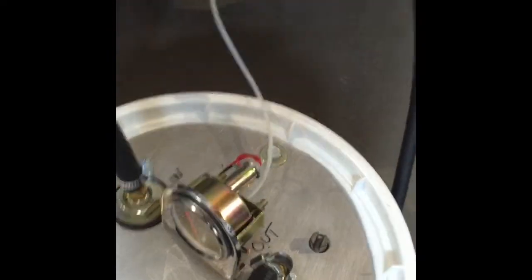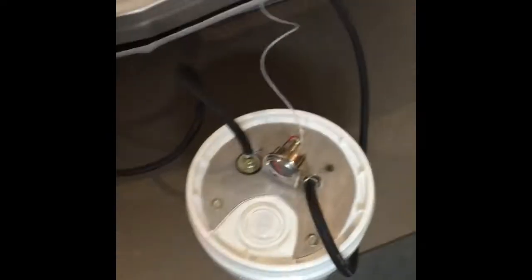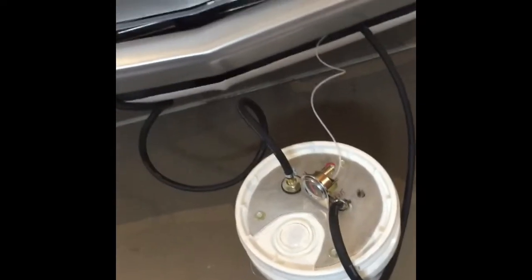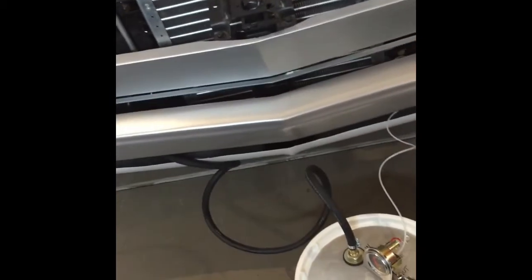And I've got this drive unit for it, for which I've built a custom little drive piece — it was in the drill. I took a piece of all-thread and milled the ends down on my little cheap mini mill — an angle grinder would work too. I had an old suspension bushing and put it in there, so that'll spin the pump.